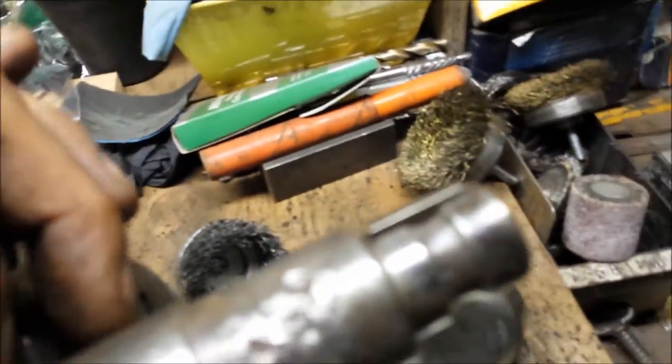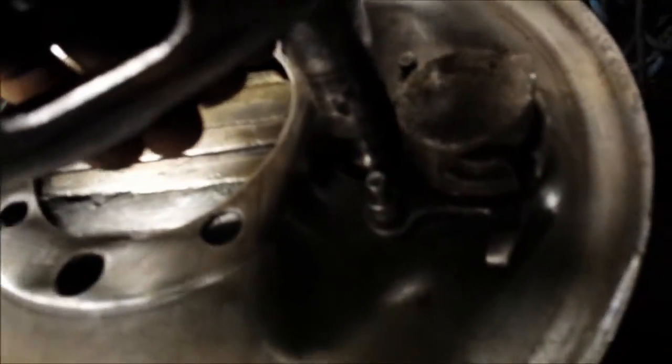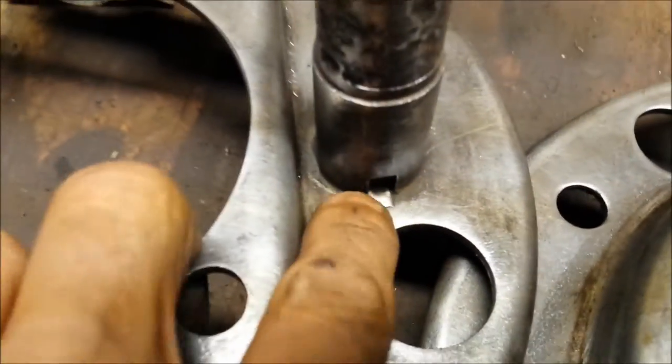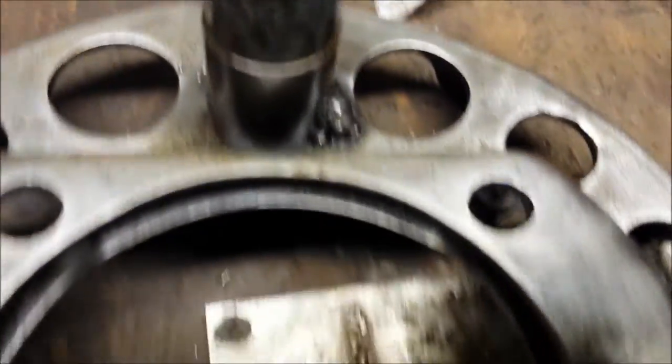It's got a keyway in it to stick through this big hole, and on the other side it gets that little arm which goes to your armature. But this other one doesn't want to move. The little piece had stretched — that groove had stretched. So what I did was I hit it with the weld. I'm not a great welder, but I hit it.